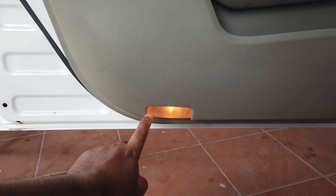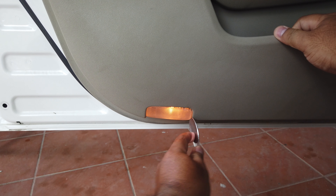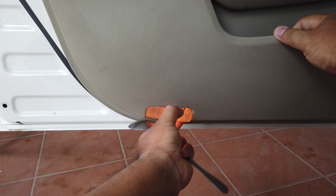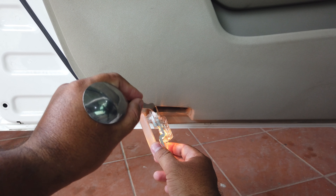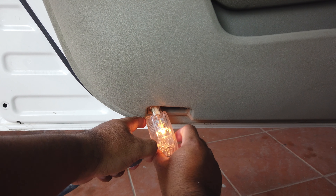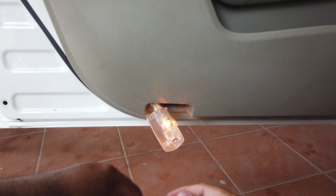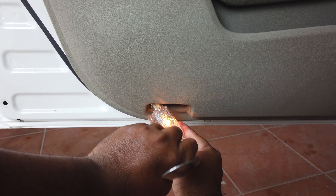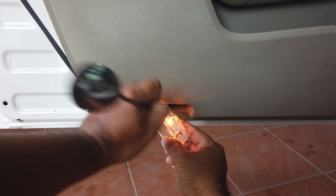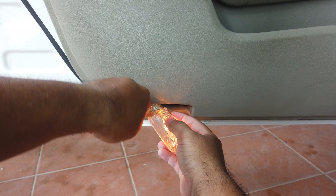If you try this side it will not work; you should try the other side. Just pop it open. For some Prius cars the cable is longer, but for my car the cable is very short. You can see there's a case protecting the light inside, so you have to gently — very gently — push it like that. Make sure it's gentle. Try to pop it from the other side. Now it's out.